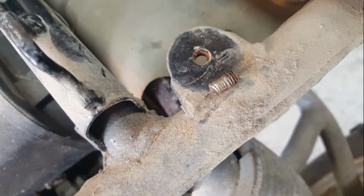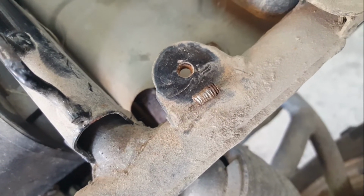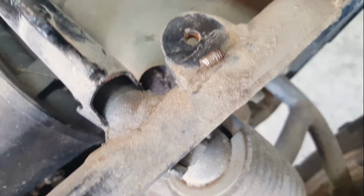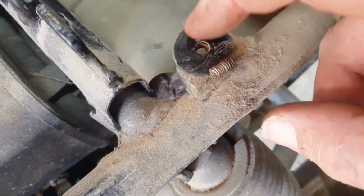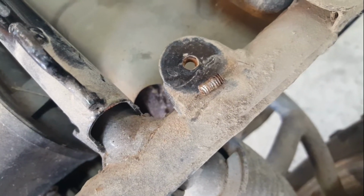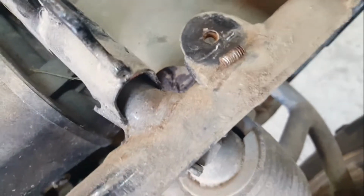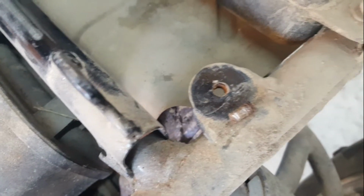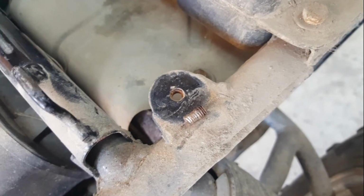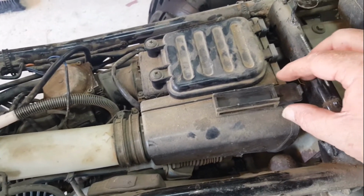So I put vice grips on the head of the bolt and twisted it and bent it, and effectively the head of the bolt broke off, allowing me to take the cover off. And now I've just put the vice grips on the remaining section that was still in the hole and gave it a bit of a twist out, and the rest of it did sort of unscrew from that hole. Now I don't know whether the threads in that hole are still any good. They're M6 threads, but at least I've got the piece out, and I can deal with that in some other way if need be. I'm going to open up this airbox for the first time.